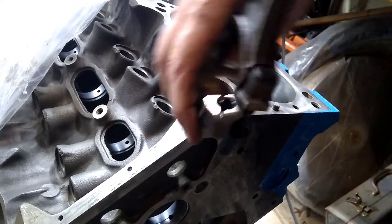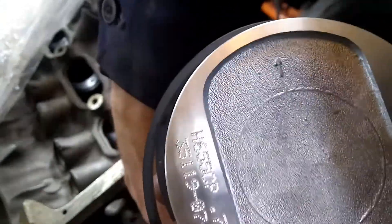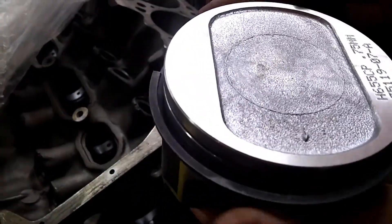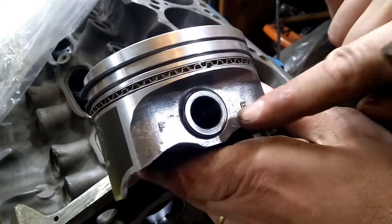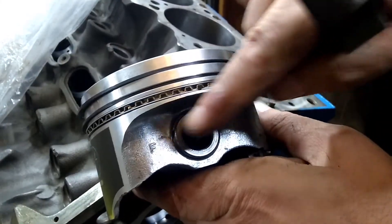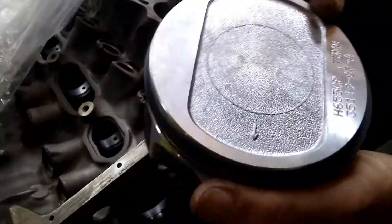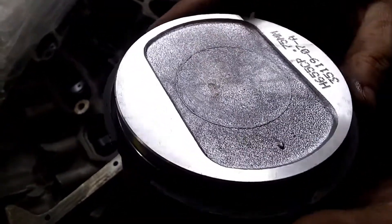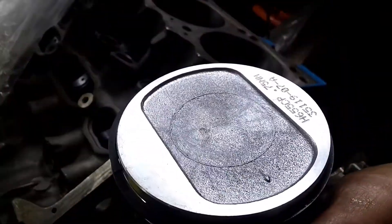If we put it in the other side, we'd have to rotate it around and then the piston's facing backwards. I've seen some people advocate putting them in backwards — there's nothing really wrong with doing that, especially when they are a little bit old and tired. The wrist pin on the piston is not dead center; it's offset just a little bit. So putting them in backwards might give you a little bit of piston slap, and some people think it gives you more power. I've never seen anything that actually tested it out to prove it, so I'm just going to install these the way they're supposed to be.